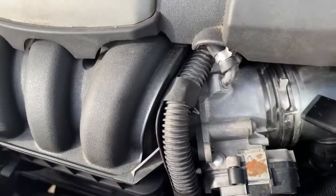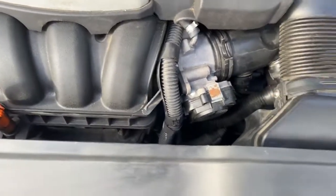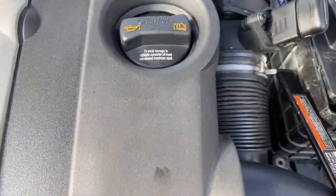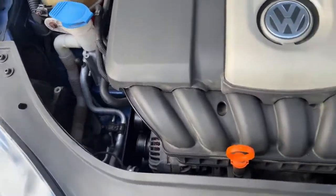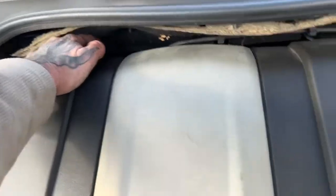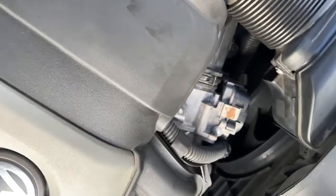I don't suggest forcing it too much. I already put it back together, but let me go through the quick process. This should flip back — this literally pops right off. You've got a clamp here; always try to leave them accessible, be generous to your next mechanic. You just need a basic pair of channel locks — grab onto this, boom, it comes off. There are tabs: one here, one here, one here — this thing feels like it's on with super glue, I'm not kidding. But it will come off — be gentle. Make sure she's tight in the back; they do have tabs in the back, make sure you're not sucking air anywhere you shouldn't be.